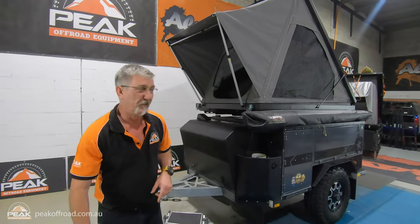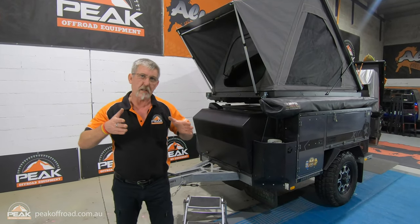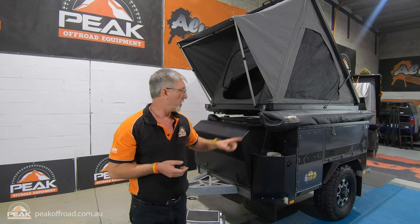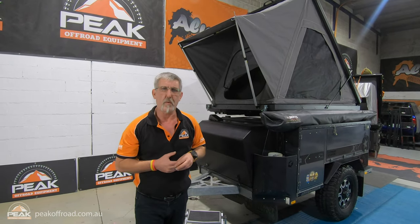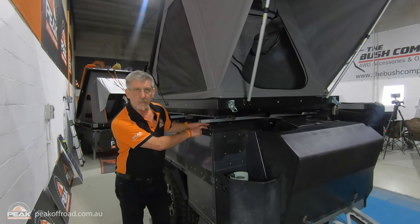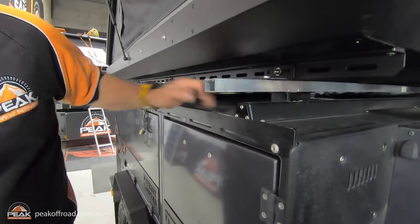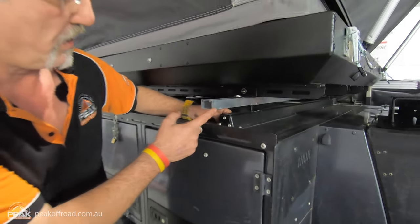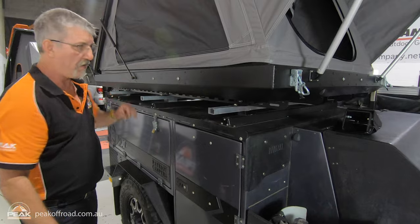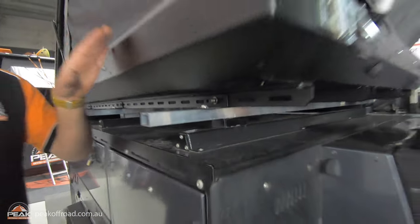The tent itself is pretty cool — it's 1450 wide, 2300 long, and it has the rails underneath going north-south. It comes with six brackets to fit it, and I'm going to show you in a second the uni-strut bars and how they've done it here. As you can see down here, the original attachments for the X1 was this little extrusion protrusion that goes on the top. What we've done is used a half uni-strut which bolted to the original bolt holes — very simple. They're 1500 long, go into the right mounting points, and it's just a matter of putting the L-bracket in and it's done. In this case the tent is at this level.